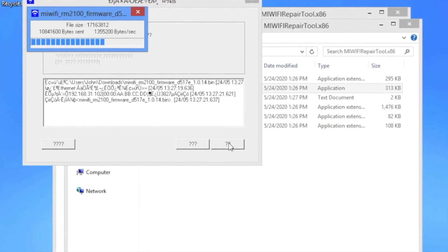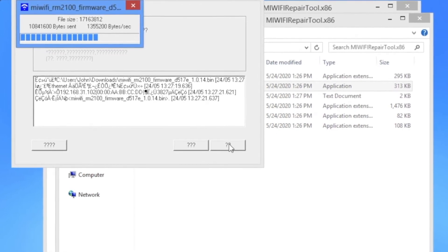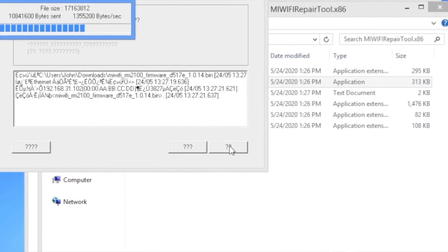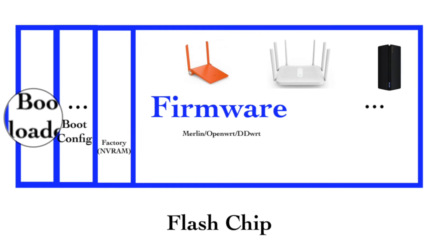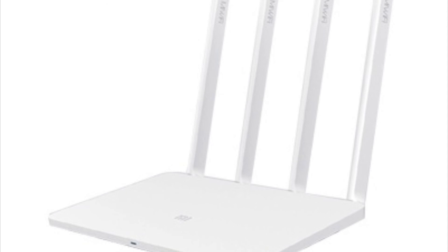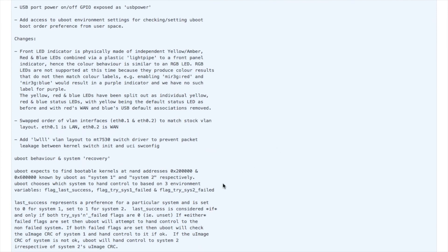If you don't see a progress bar, close the tool and retry. Sometimes you just need to retry to make it work — this repair tool is just that junky. If it never succeeds, check the firewall, antivirus, and other settings of your Windows operating system. For most MiWiFi routers, if you haven't touched the bootloader partition, you can always flash back to the stock firmware and don't need to worry. But for the third generation of MiWiFi routers, things are different — it's possible to brick if you can't boot into the operating system. So please watch out and do research before installing firmware. Each device has a different recovery mode, so make sure you know all the details of your device.